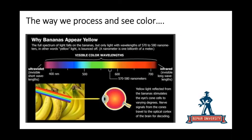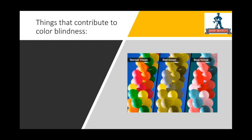Here's how we process and see color. The human eye only picks up from about 380 to 720 nanometers — before and after that you can't perceive much. What you're seeing is a byproduct of what reflects back. A banana falls in the 570 to 580 nanometer range, so our eyes perceive yellow because the reflected light is in the yellow spectrum. When we talk about color, we're talking about reflectance, Kelvin, hues — all these things.